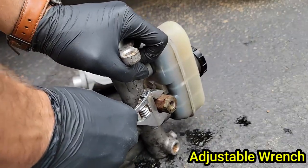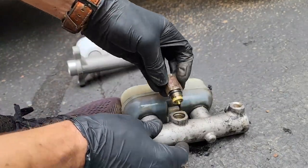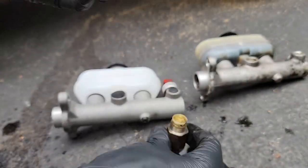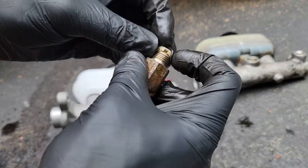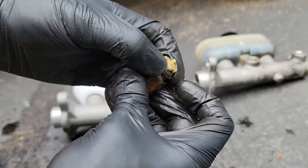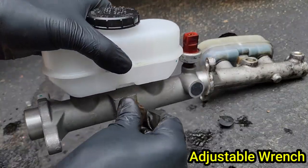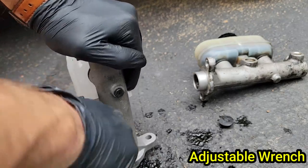Now as you can see, there is the o-ring you need to replace. Roll the old one up and off. Grab the new o-ring and put a tiny bit of silicone paste around it — I didn't catch that part on camera, but you want to make sure you lube it up a little to prevent it from binding when reinstalling. Don't worry if this plastic piece falls off — just put it back on. Once you get the new ring on the metal part, you can install the electrical connector on the new master cylinder. You are putting metal to metal so give it some force when tightening.